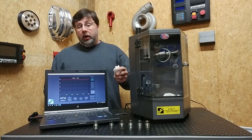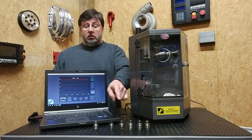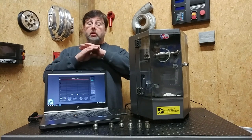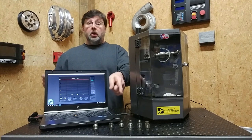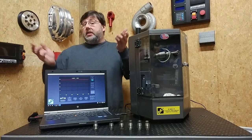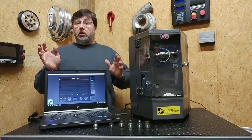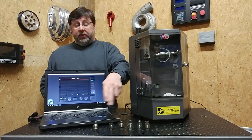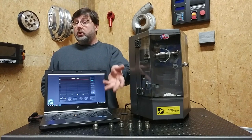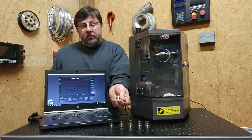We didn't discuss another thing a lot of guys are doing — they're buying the shim kits for these relief valves. And I'm going to tell you, the plug and the shims, they're completely worthless. If you shim it, you're effectively going to raise the pressure on it so high that it's never going to open. This valve has absolutely no shim in it. Except for one valve which was pretty much worn out, we had to put one shim in it just to get the pressure up. And once these valves are worn, they're all going to be set at different pressures.